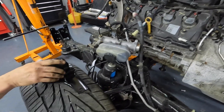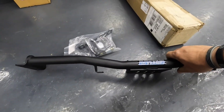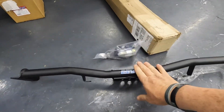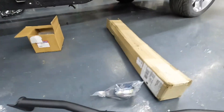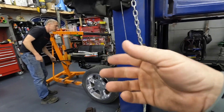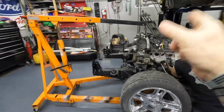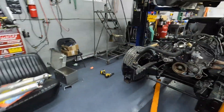We're swapping that motor mount first instead of just adding a spacer. Another part I didn't show you — Stifflers actually makes a crossmember for this truck, which makes life 100% easier. There's your 6R80 mount. So yeah, that makes it much easier to bolt in your 6R80 as well. So far we've got your motor mounts covered, your trans covered, and the passenger side is just the stock mount — that's fine. We're about to have your headers covered too.